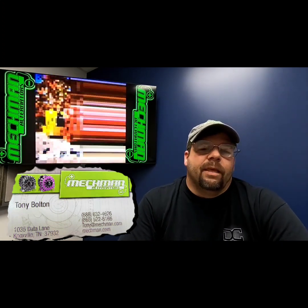Everything's going to be fine. Really, it really is. Because wasn't that what your stock alternator was kind of doing? Fluctuating a little bit? Probably. So keep that in mind. Just because the battery manufacturer says you must charge at 14.4 volts, they're doing what they're supposed to be doing. They're giving you the best number for performance out of their battery. So what that means is if you charge it a couple tenths lower, a couple tenths above, you're going to shorten battery life, but by how much? 10 minutes? 5? I mean, where do you draw the line here?